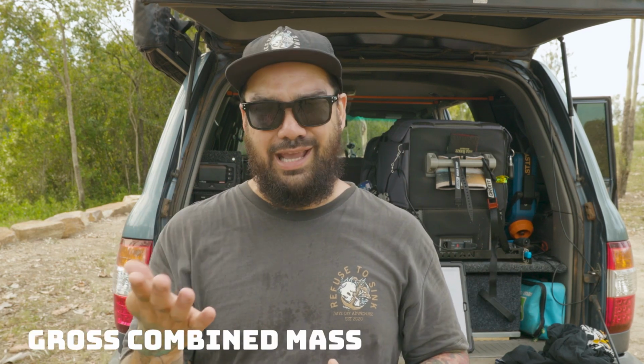So GCM and GVM are two completely different things. Like we said, GVM on one hand is the weight of your car, GCM is combined weight. So essentially, if you have your car and a caravan, you have the weight of them put together. So for instance, I can't exactly remember what my GCM is, but say my car's 3 ton and you've got a caravan that's 3.5 ton. Essentially, I've got 6.5 ton worth of weight. So now my car probably has a GCM of 7 ton. So I've literally only got 500 kilos to play with. Unless you know the weight of what you're towing, it's very risky to be over with your GCM.